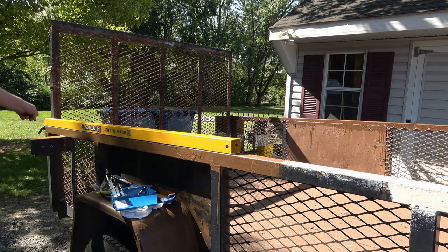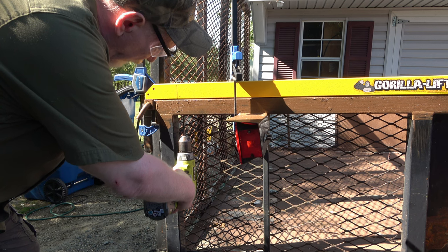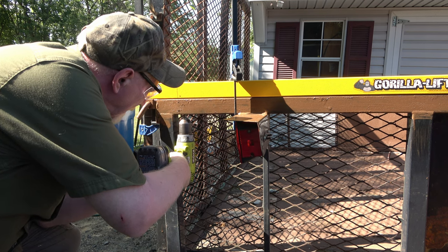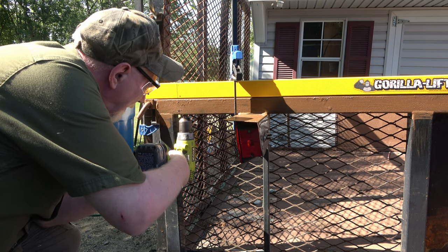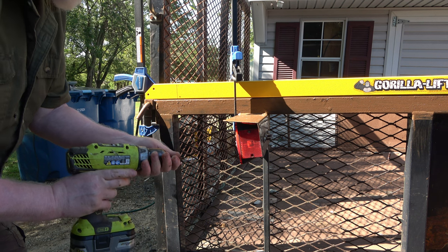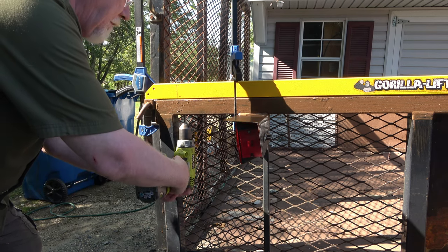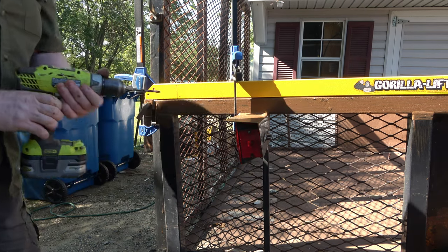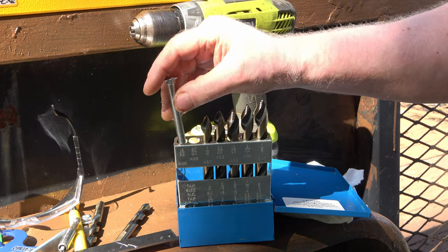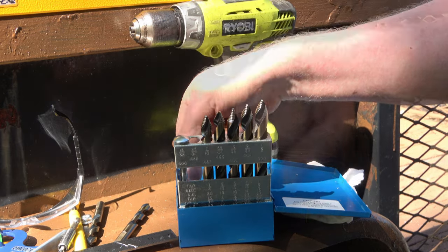Then I'll have to retrofit that front. I'm going to use this square stock as a guide and go straight up with my bit through here and into here. I don't think the bit was long enough so we'll extend it a little bit. Choosing a bit where the square will fit snug to help hold that bolt when it pulls down to tighten the nut — 13/32.